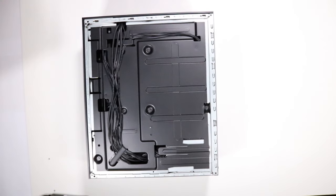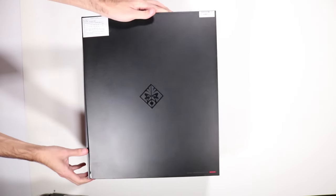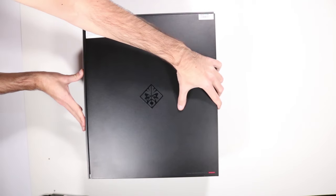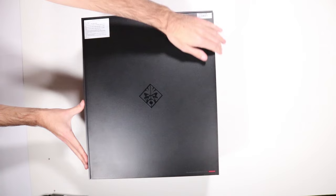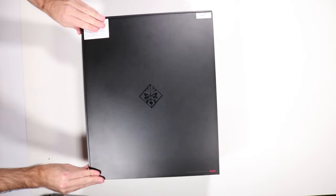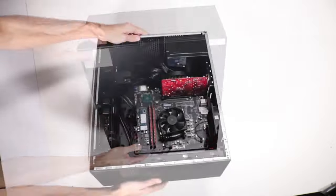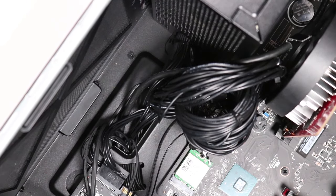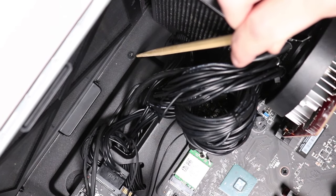Replacement: Align the side panel with the bottom of the chassis and position it securely on the retaining tabs. Push the side panel forward and from the top and back of the panel, slide it firmly sideways until it closes and clicks into place. Turn the unit back around. Push aside any obstructing cables beside the power supply to access and replace the single P1 Phillips-head screw.